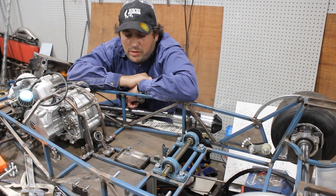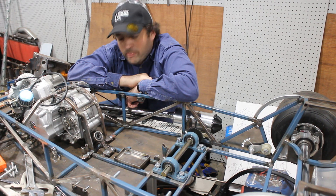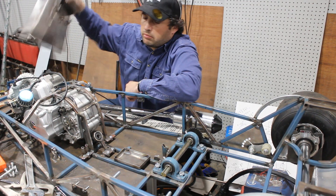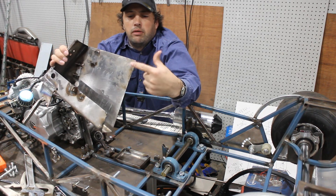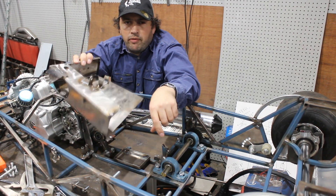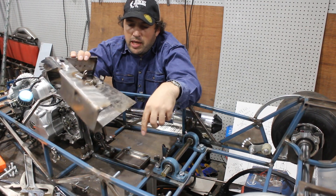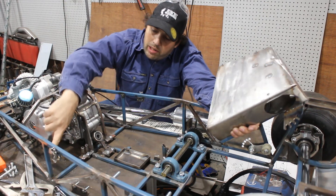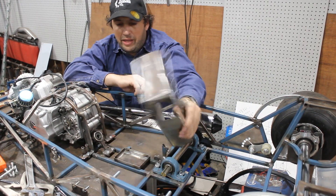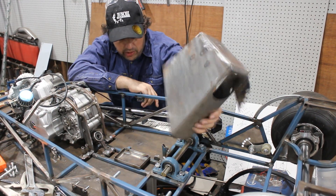I forgot to mention there was a bit of deconstruction required. It's needed to happen for a little while but I was putting it off — now I'm at that point, it has to happen. The centre console needs four rivnuts put in here to mount the relays. I might put in an extra one just for an earthing strap. So that had to come off to do that. I've also got to do some on the side rails here for the fuel line to bolt onto, and there was no way to get the drill through there with this in place, so that had to come off.